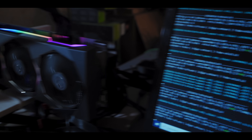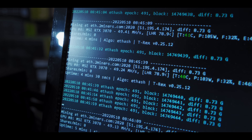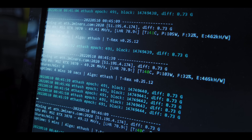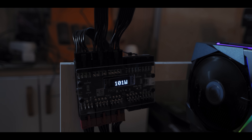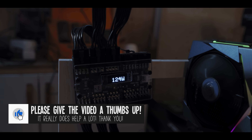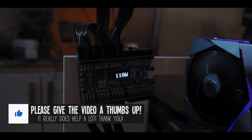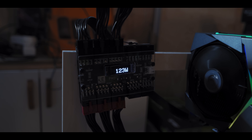Now we're up and mining on the LHR card with the 80% partial unlock in the older version of T-Rex Miner. You can see we're getting just below 50 megahash at a 78.9% unlock. Here you can see what I mean about the power jumping around — it sticks around 120 and then suddenly jumps down to under 100, and sometimes it dips well above 130 as well. That's what we want to check — is the 100% unlock still doing this, or is it more stable?